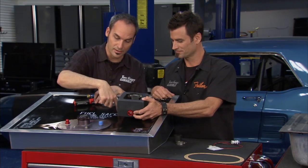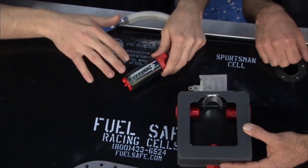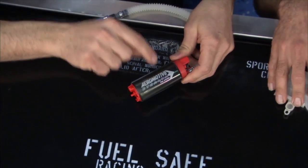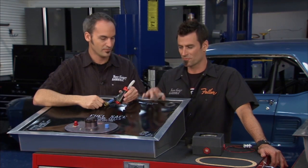This whole assembly is going to drop straight down through this big opening right where the fuel is. Now speaking of having fuel at the pump, this is a Stealth from Aeromotive — a 340 liter per hour pump. It's a huge amount of flow for this tiny little guy. We're going to put it inside the fuel cell, which is not something you normally do. Getting the pump in the fuel cell is really important, especially as you're drawing that much fuel. Hot rod guys and racers have all gone to the in-tank pump.